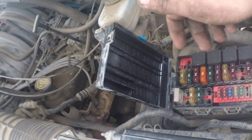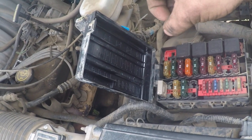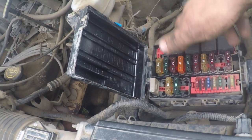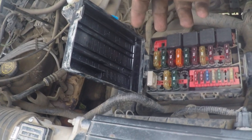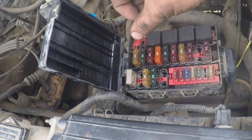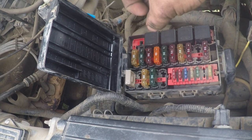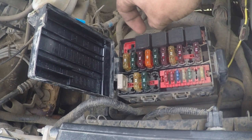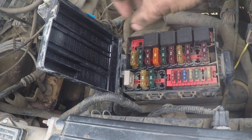I wanted to do a video showing that sometimes you've got one problem with three causes at the same time, and how to eliminate all the possibilities to find out which ones are actually causing the problem. The inertia switch was tripped — it wasn't the actual root problem, but we bypassed it to make sure we weren't ignoring something that could still be causing a problem. We eliminated all of the switching problems with the goal of getting the engine to run, then worked our way back through the system one at a time.